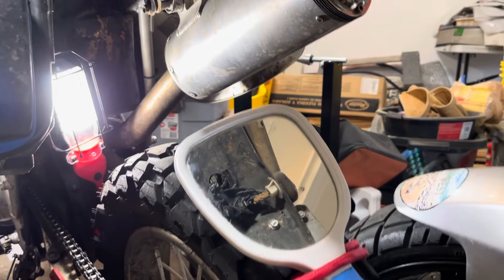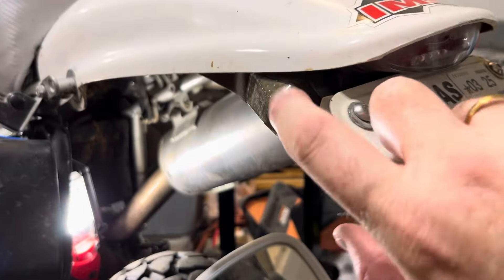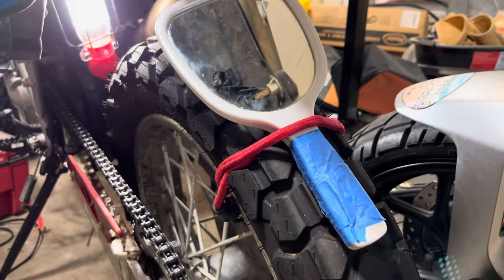This time I'm going to extend the wires and run them along the sides of the fender and tightly up into that hole. If you're going to do this stuff, think about rocks — think about protection. Otherwise you're going to have problems like this where the turn signal doesn't light up. The other one works fine.